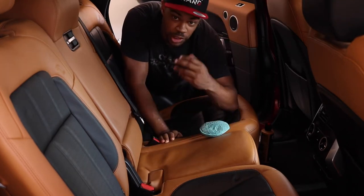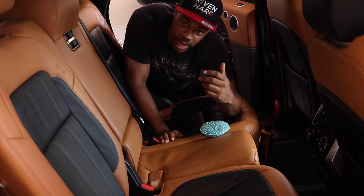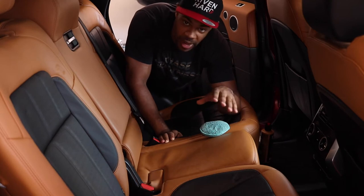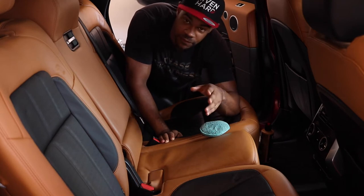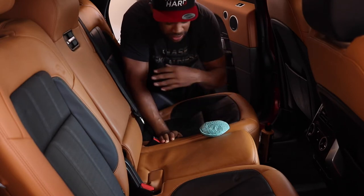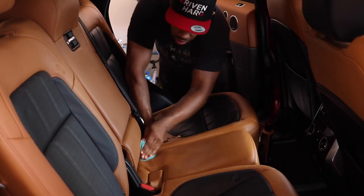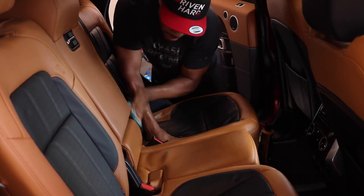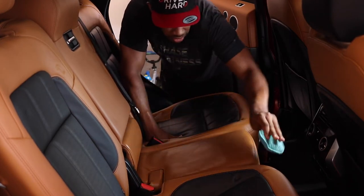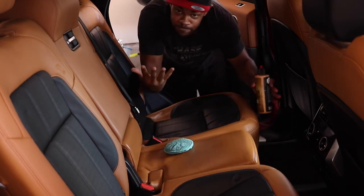Hey guys, while you're doing this to your Land Rover, occasionally you're gonna get a low battery, start engine message from the dash. And don't panic, it's just a stupid fail-safe Land Rover has to keep your battery at like 90% all the time. So I just start up the vehicle, let it run for 5 minutes or whatever, and then just turn it back off. And that's good to go. It just tends to happen when you have all your doors open and everything.